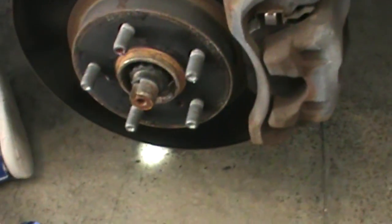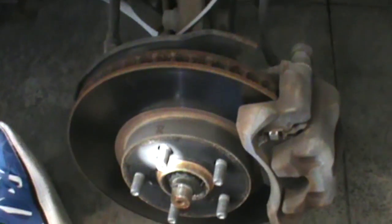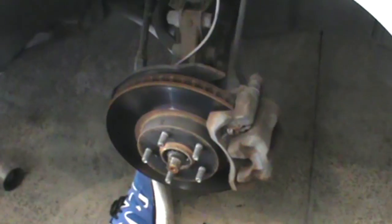As you can see, we don't have any leaks here, so this overall looks very good. The only thing I noticed — if you look at the floor as we were taking the wheels out — we got a lot of residue, a lot of dust, which might be what was giving the squeaking. We'll see after a test drive, but this is normal especially in an older vehicle. This is a 2009 — not a very old vehicle — but still the calipers are in good shape, the brake pads are in good shape, everything looks to be in good shape.